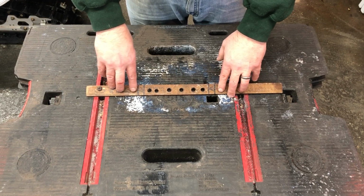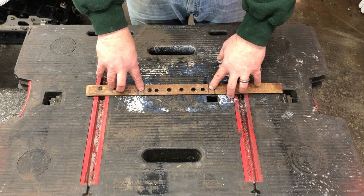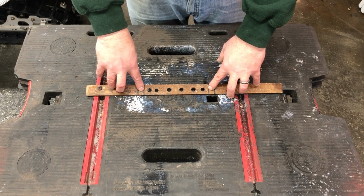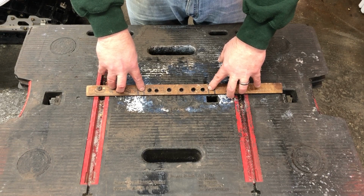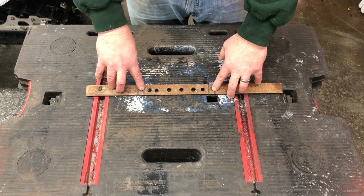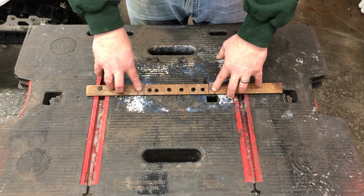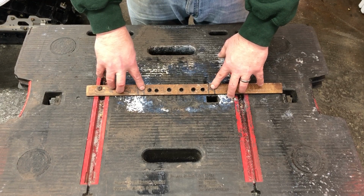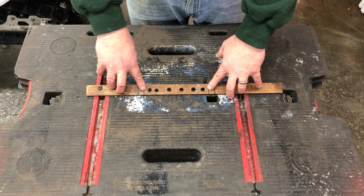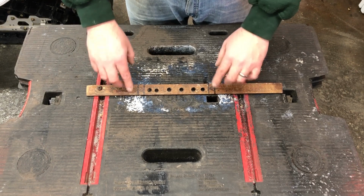And then what I did is I created 2 additional lines inside of that, which is basically where I want the backers to exist no further past that point. So essentially, I have 3/4 of an inch on each side of the stud pattern that it's not going to be anywhere near the window. Which is good because you don't want your studs and your backers interfering with your drivers.